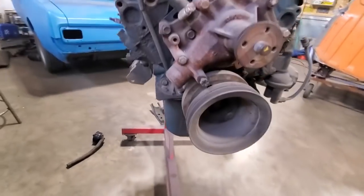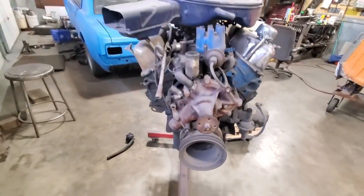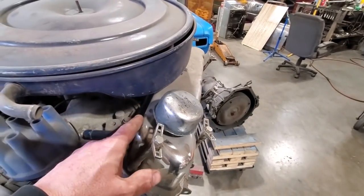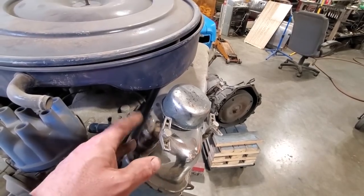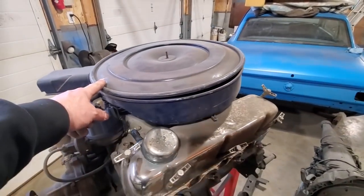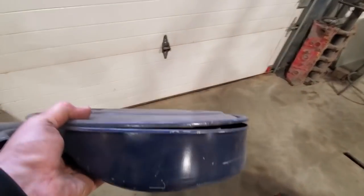For anybody wondering if it's a 289, I've been told by many - four bolts, three bolts. Four bolts is 302. So I got to pull the pulley off it, the mounts off it, haul the air cleaner off. This had a chrome package on it - I was never a lover of that stuff. It's nice when it's new but a lot of work. Over the last number of years I got into painting everything, just so much less maintenance. I picked this up off a 351 that I got for parts, and I'm going to paint that up and put it on.